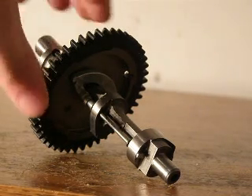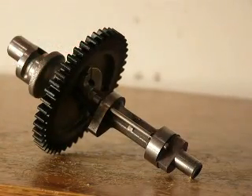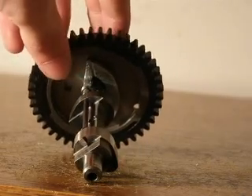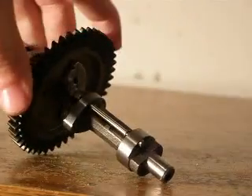The reason for that is, when you're starting an engine and you're pulling on the cord on a small engine, it builds up lots of compression at the start. And you don't want to break the cord or pull your arm out every time you try to start that sucker up. So these things reduce the compression at the initial start, so it allows for easier startup.